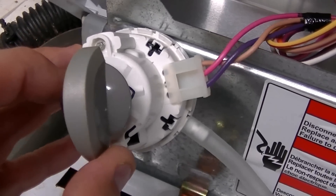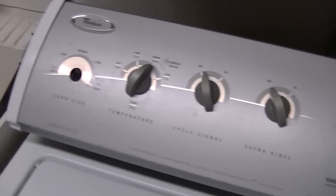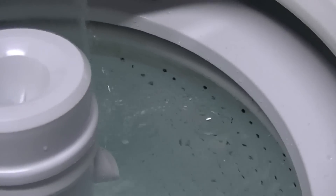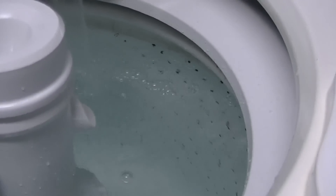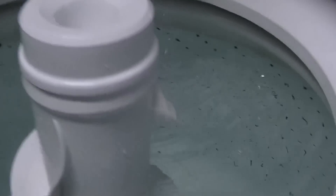I'm resetting the switch and turning it back on to have it fill a little bit more — it'll turn off when it reaches the new setting. You can see the water is getting higher and higher each time. I recommend quarter-turn screw adjustments so you don't overflow. Don't disconnect the water or the air hose. Now we're only about almost to the top.